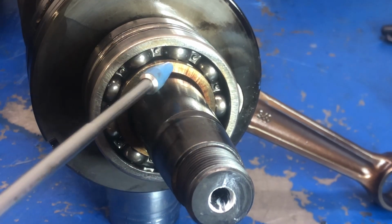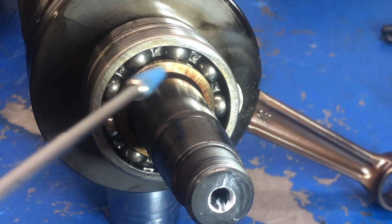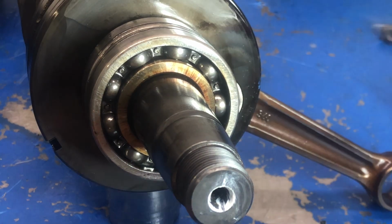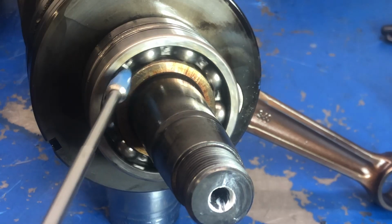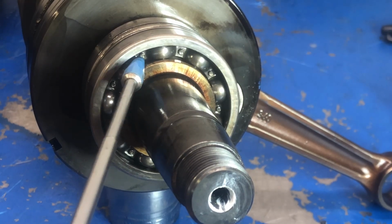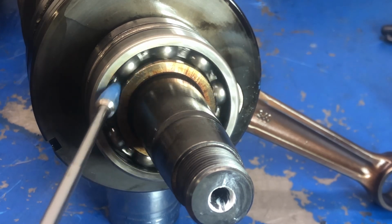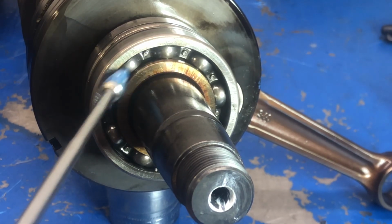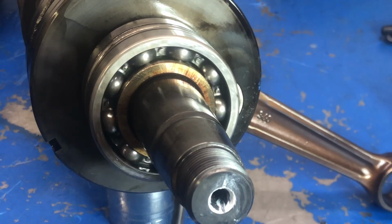So let's examine these crankshaft main bearings on the mag end. You see all these striations coming out from the center here, all this brown, likely rust, corrosion. I see right away it has steel cages in it, totally wrong for an aircraft engine. It should have the fiberglass reinforced polyamide bearings in it. So these are, who knows what quality, where they came from, what they're supposed to fit. Don't know. They don't belong in an aircraft engine at all.